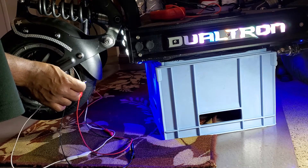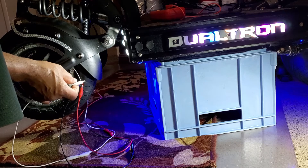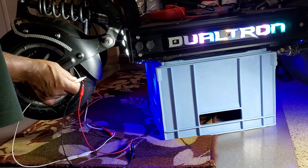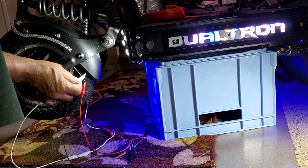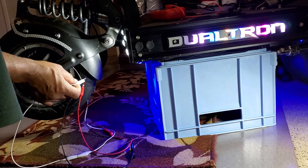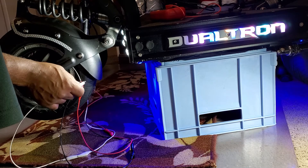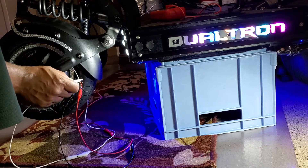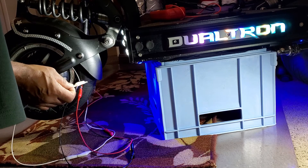In the first part of my troubleshooting I reconnected the damaged wire from the RGB front wheel and tried to find which wire connected to which. The problem I ran into was that both sides had different color coatings — the side coming from the stem battery had a different color than the side going to the RGB lighting on the wheel. So I played around with connections until I saw which one would light up the RGB lights on the side panel and on the column.